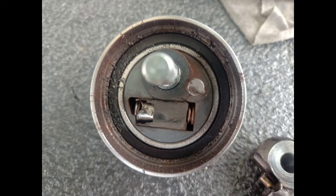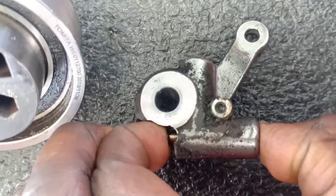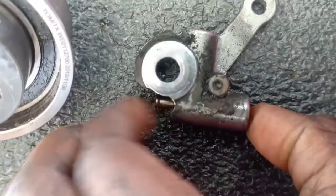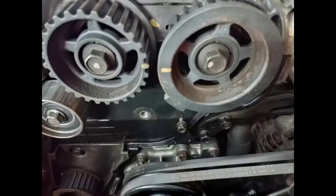I just got the okay from the customer to go into the front cover. And this is where I found basically a damaged timing tensioner. This was recently installed about a month and a half ago. As you can see, I'm moving this with my finger effortlessly while I'm holding the camera. So that's not how it's supposed to be. I'm going to double check my timing also to make sure it's on point before I go back up with this engine.